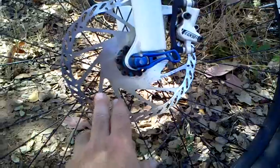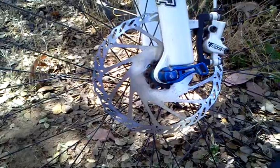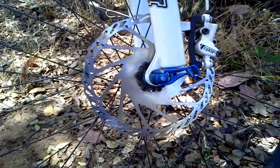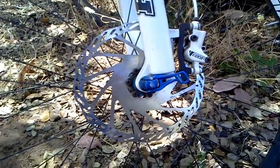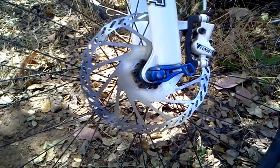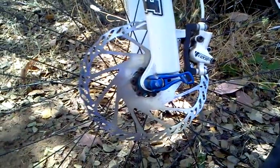And so if you're having brake issues, you may just try going up the size in the rotor. Rotors are less expensive. If you do opt to go to a bigger or a different brake setup, I'd really look at the Shimano's. Like I said, they're extremely good performing brakes. I like the way they actuate and everything. You barely have to think about them, and that's a sign of a good bike part. But anyway, look into your brake rotor size.